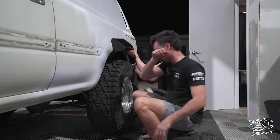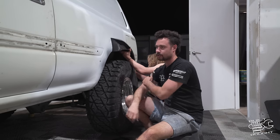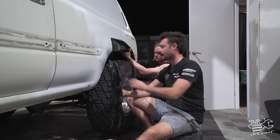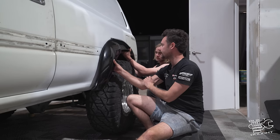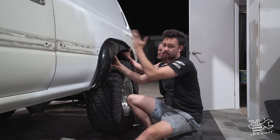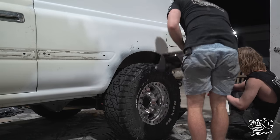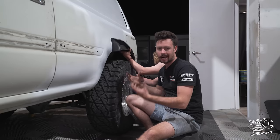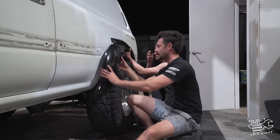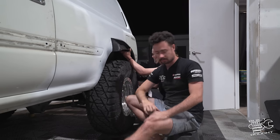For the rear, we've got a set of flares. The problem is I've welded in the back door, but every 80 series on the planet is two-piece because it has a rear door. I spoke to the guys at the flare place and there's nothing on the market that follows that same flare shape for utes or dual cabs, so we had to go two-piece. We'll pump some expanded foam in the middle and join it with fiberglass filler. We'll mark it out, prep it, sand it, clean it, run some bonding glue and liquid nails, and get it set overnight.